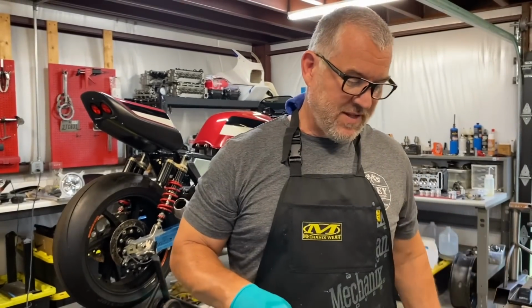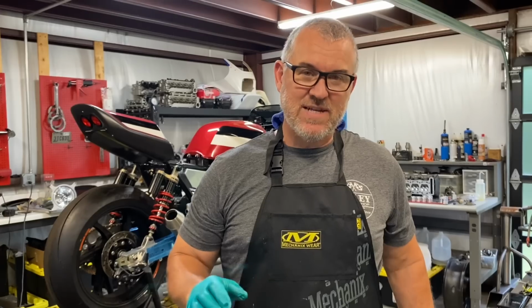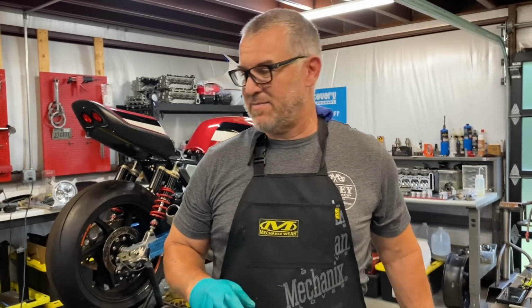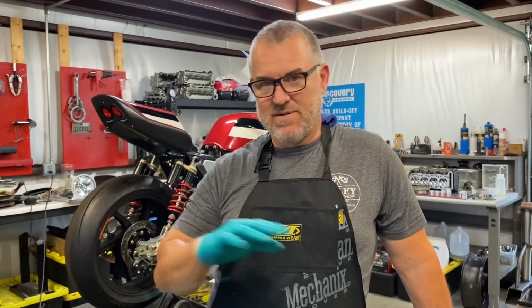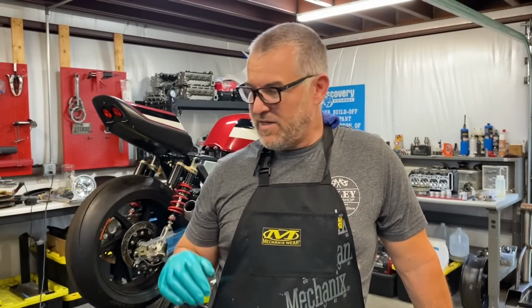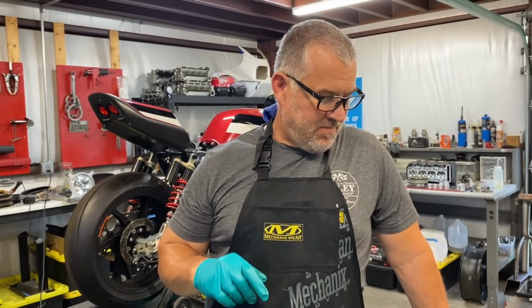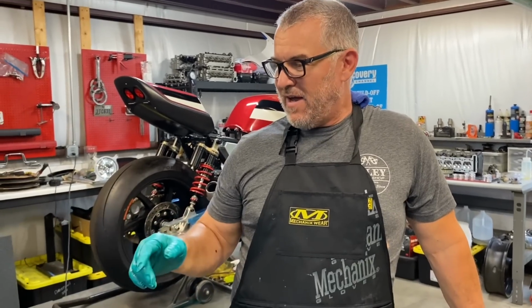And there are some little things that you just need to pay attention to detail. That's what a good engine builder is, just really detailed. That's the big thing. And then after that, it's experience, understanding relationships and tolerances and clearances and compression ratio and cam timing and valve to piston clearance and all that other stuff. But anyway, so we got right off the bat, we found that.